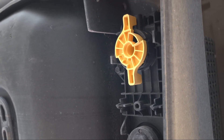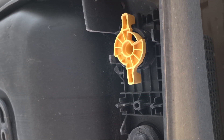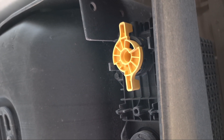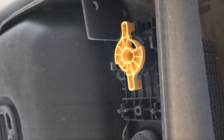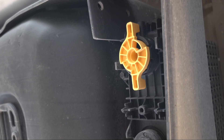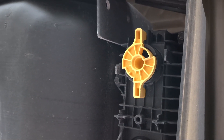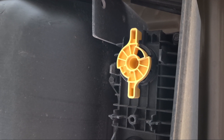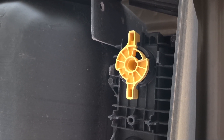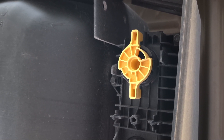So what you're going to do is switch your engine to off. Get underneath that vehicle and put yourself a bucket underneath there. You're going to drain that diesel fuel conditioner module, which is what it's called. Turn the drain plug counter-clockwise until it stops. Don't use any tools — just do this with your hands. It's going to be approximately a half gallon or so. You're going to drain it into the bucket.